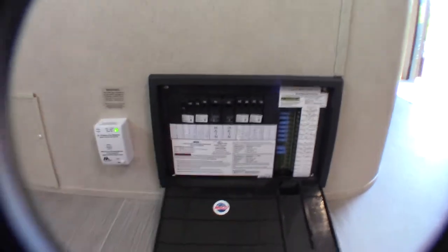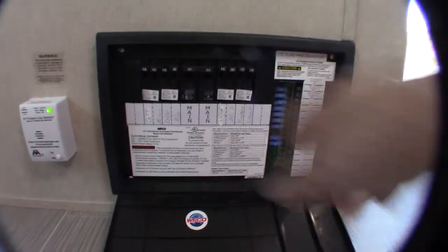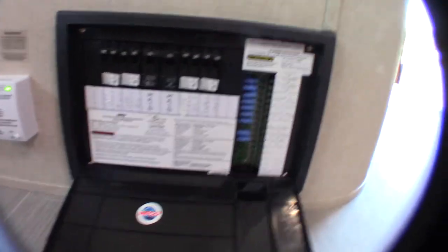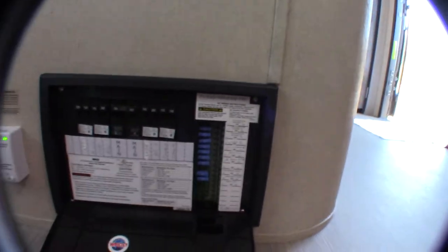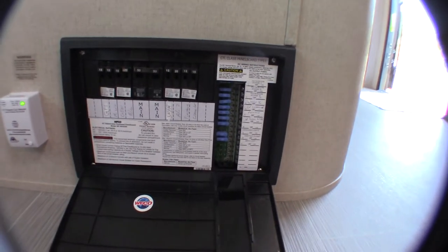This device down here is your power converter — it converts 110 AC over to 12-volt DC. You have 110 AC circuit breakers just like you'd see at home, and they're all labeled. The power is converted down to 12-volt DC on this side — you've got 12-volt fuses here, all labeled. If you're plugged in, it's also going to send 12 volts to your battery and keep it charged. If any of these fuses blow, they'll light up and you can see them through this tinted plastic. If you see a light inside, you know you blew a fuse.